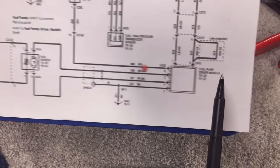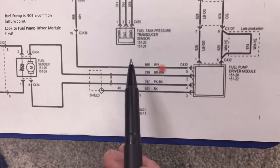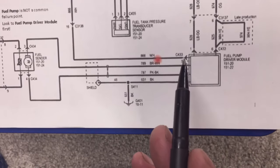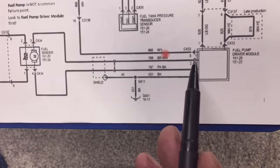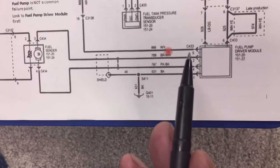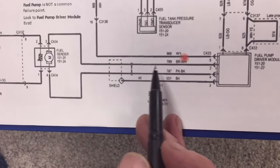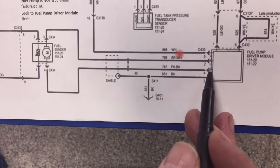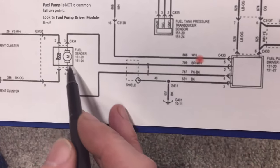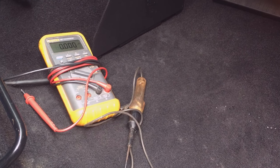The two wires going into and out of the switch — there's a white wire that feeds power to the fuel pump driver module, which is in the back of the truck by the spare tire. Mine has been corroded and the casing has come apart, so I know this fuel pump driver module needs to be replaced. I need to determine if there's power coming to it and make sure the ground is okay. I can also run a jumper from the white wire to the brown-white wire that feeds the fuel pump, and from the pink-and-black wire to the black ground wire. If I put a jumper between those four contacts, I should be able to power my fuel pump.